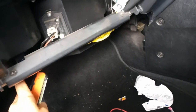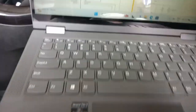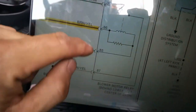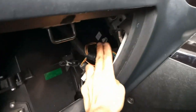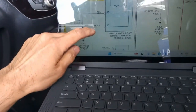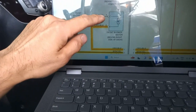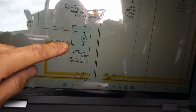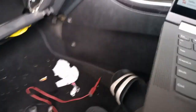I don't get power to the blower fan, so I look at the wiring diagram under the engine bay — engine blower, then to the relay. The blower motor relay is right inside the glove box. The way I see it, power goes to the control, then to the motor, to the blower fan motor.